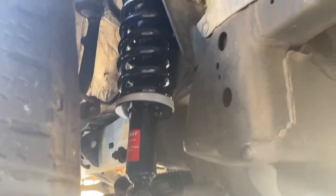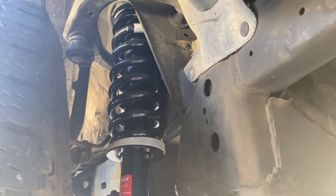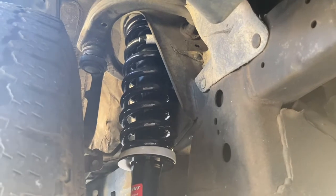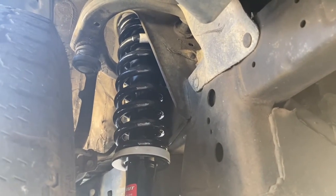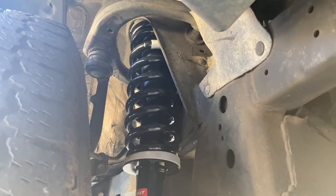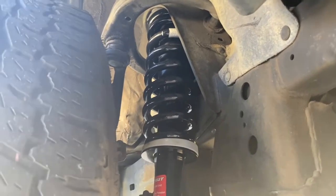This is actually off of a Toyota 4Runner of the same year. The Toyota 4Runners had the exact same strut length, and they also had heavier springs, and they are the proper part to use for a four-door Toyota Tacoma. You can use the ones from Advanced and all that for the single cab and the extended cab models, but not the four-door.